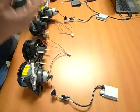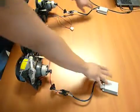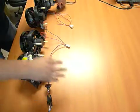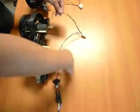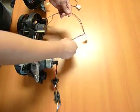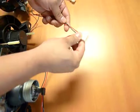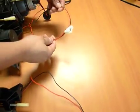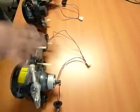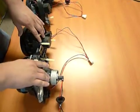Now moving on to the angel eyes issue, this is going to be tested in a different location. All this stuff will be taken out of the equation, because what we're going to be looking at is all these wires coming from the headlights. There are going to be two sets of red and black wires ending in a connector like this, and the same for the other side as well. Now you said one angel eye side is out for the entire headlight, so both rings are out. We're going to pretend again that's this headlight.